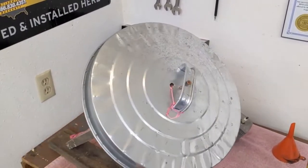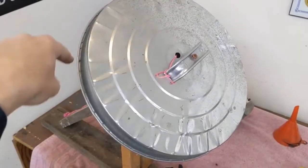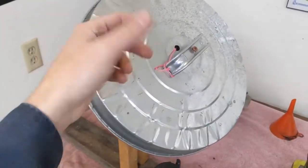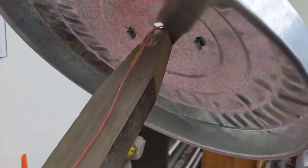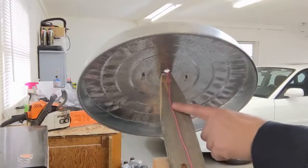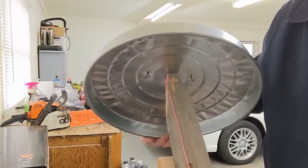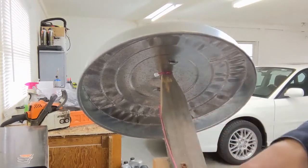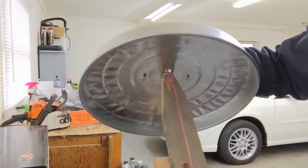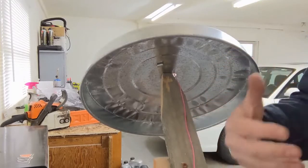So let me show you a quick visual of the issue that had to be overcome. This is the setup — the steering wheel is able to pivot, and the wire represents like a horn wire or any wire that has to come from the steering wheel and go down the steering column. Just one wire for demonstration, it goes down as close to the center as possible. Notice as I turn the steering wheel what happens — the wire gets twisted. You can see it up here getting twisted, it wraps around the steering column. Move it back and it comes back, but the opposite direction it gets twisted again. You can see this wire being stretched, twisted, rubbed on over and over. That's an issue.